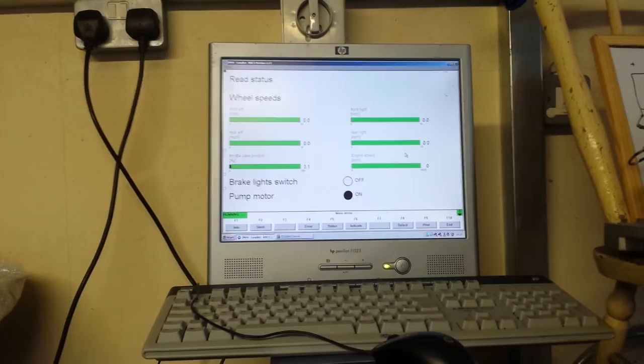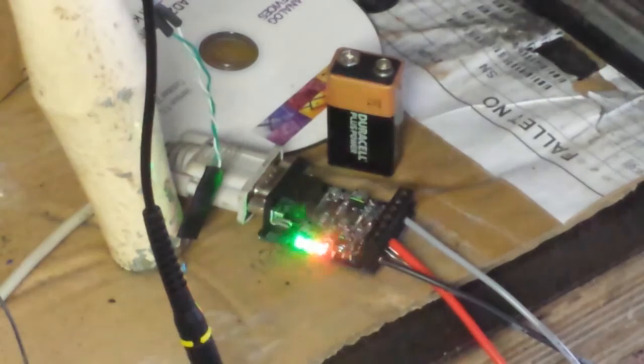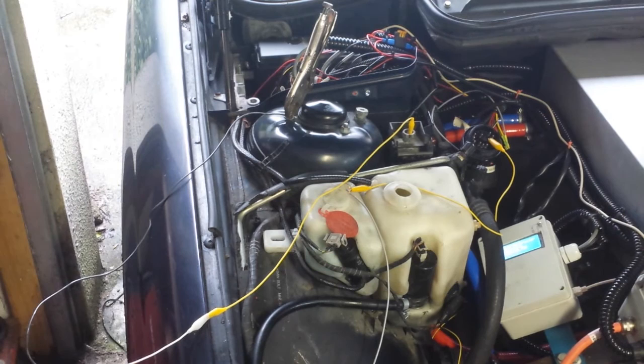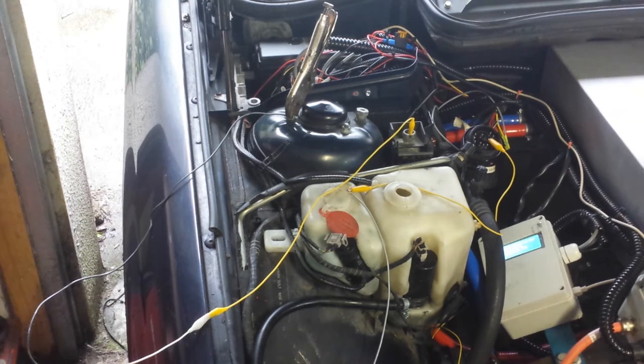You can see the little ADS board itself doing its thing — it's just a serial connection with some terminals to connect to the various data lines on the car. I've just thrown the wires in: 12 volts, ground, and the signal which is called the K-line.